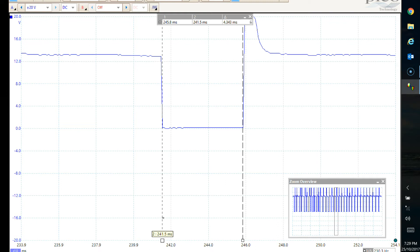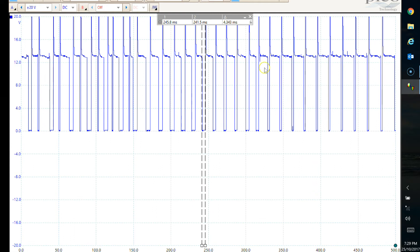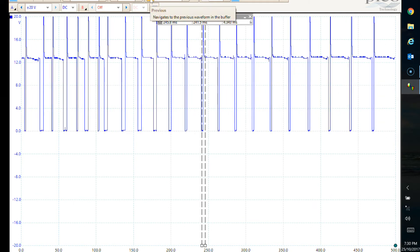So at that point in time there's about almost twice as much fuel going into the intake manifold. The information you can get from this is just phenomenal. It's a shame this Picoscope doesn't go above 20 volts, because you'd see the final voltage spike - that's an induced voltage into the wire. As the pintle snaps shut, it actually creates a current flow in that circuit. So it's quite normal. There's the start again - good stuff. Known good waveforms are really useful to have.